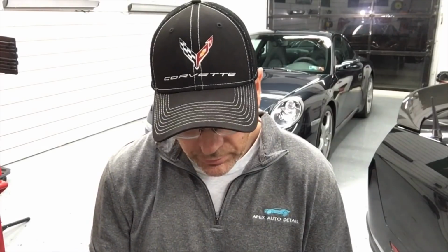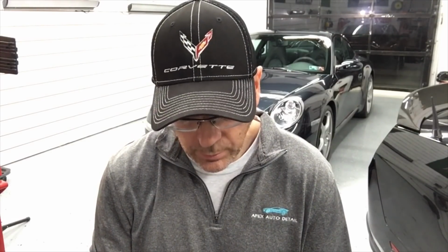Okay, the next question goes to Richard, and he wants to know, across all polishers, does the speed setting stay the same, or does that change drastically from polisher to polisher? For me, pretty much they're going to stay between the 3rd and 4th speed setting throughout all the polishers. That all depends on what I'm working on, what type of pad I have attached to the polisher, and what type of clear coat I'm working on as well. There's a lot of variables there, but for me, it's going to stay between the 3rd and 4th speed setting. There is no reason whatsoever to take a polisher above the 4.5 top speed setting.